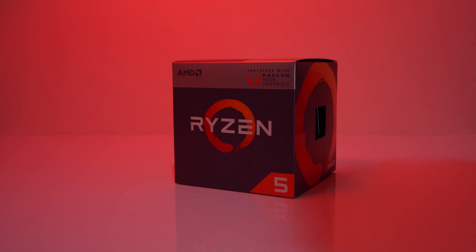Alright, enough of the explainer — let's get on with what we're doing in this video. We're going to be using the Gigabyte B450M Gaming motherboard and updating its BIOS to be ready for AMD Ryzen 3000 CPUs. I'm going to be using a 2400G CPU for this, and the method will be similar whether you're using ASRock, ASUS, MSI, or Gigabyte. I will explain in the BIOS where to go for the different motherboard brands.